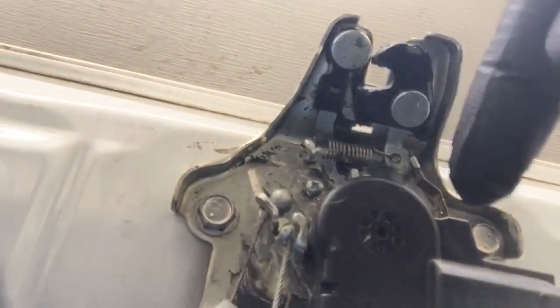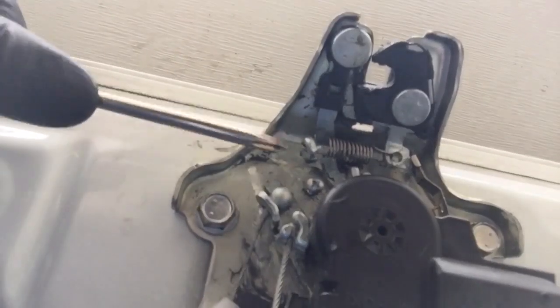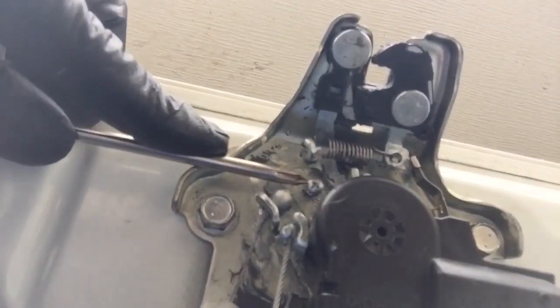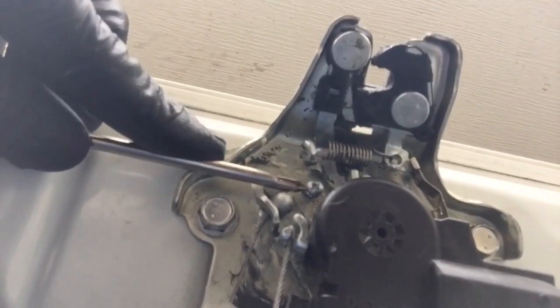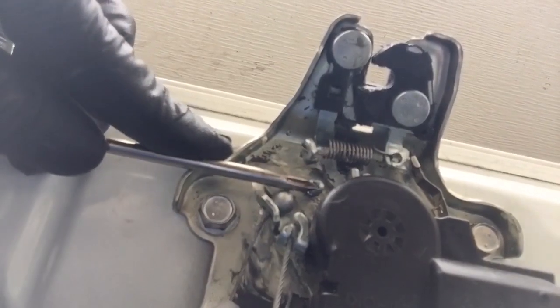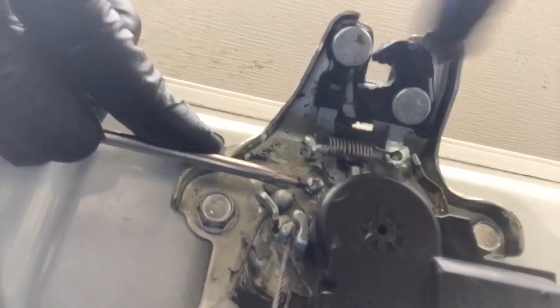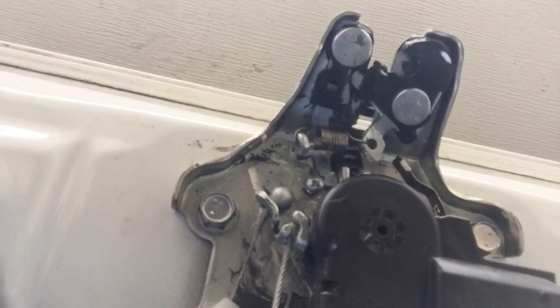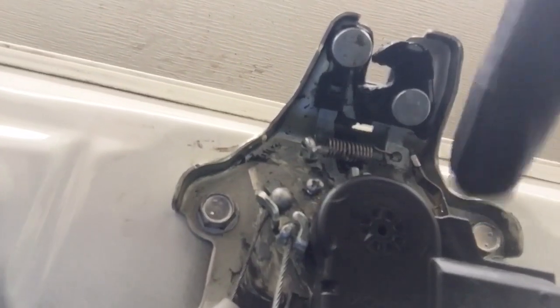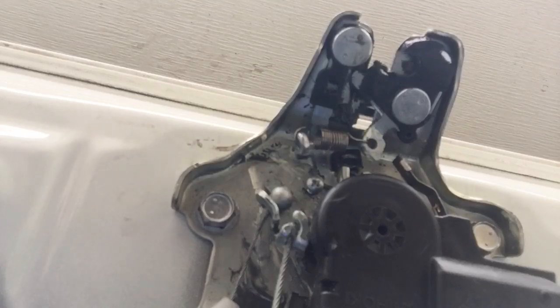Anyway, what I did to determine where that should be is I held the screwdriver really tight up against the body here, and I kept testing, moving it further or closer in this direction, figuring out where the best point would be that would go this way and stop, but not allow the spinner to go all the way around. Here, I'll show you. See how that bounced back in there. Hit it, disengage the lock, spun back. Perfect. That's all I had to do.